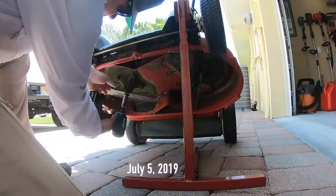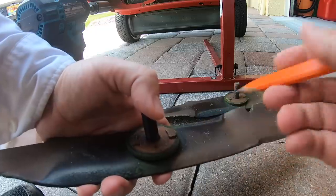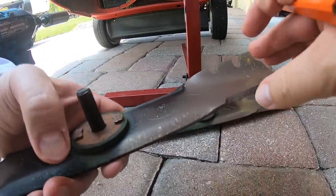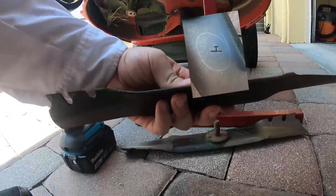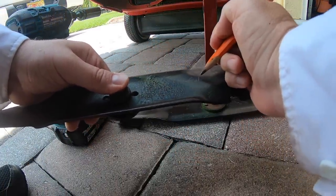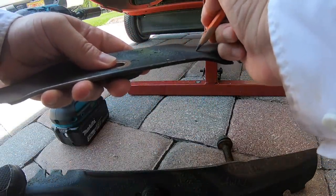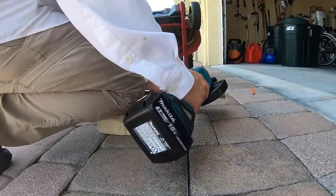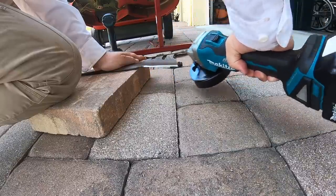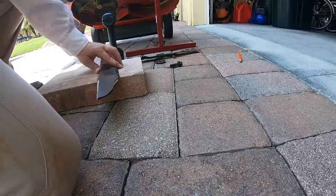A few of you asked me to compare the Time Master cut real quick, and I wanted to sharpen the blade so everything was the same. You guys know I'm a fan of iconography — on the stock blades of the Toro Time Master, that's not a funky number four; it's actually designed to show you the position of the blade so you don't put it on backwards, which I'm well known for. I go an extra step and actually mark the lawn side of the blade with a pencil to be double sure. Also, I'd like to thank those who warned me about sharpening blades near vehicles — the shrapnel that flies off can nick your paint or windows.